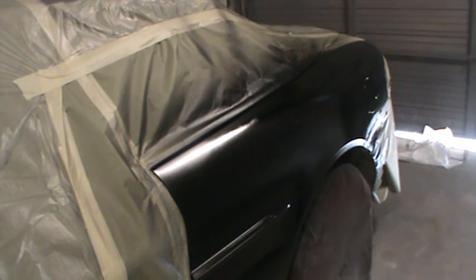Most of the guys in the garage got right around 13, 14 CFM seems to be the going number, the guys that are painting pretty regular. Again, it depends on how much of the car you're going to paint, and all that comes into account when you're considering compressor size. But 30 gallon is sort of small. I'm sure there's guys out there that have painted with smaller. I have. The compressor tends to run a lot, and that can produce water.